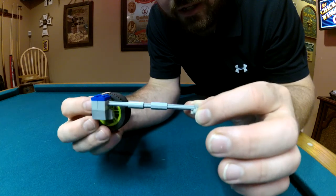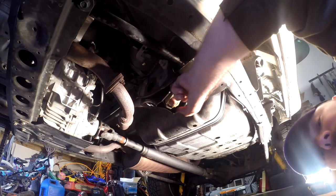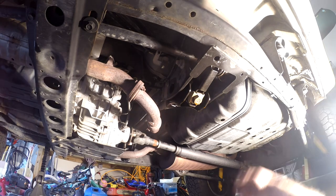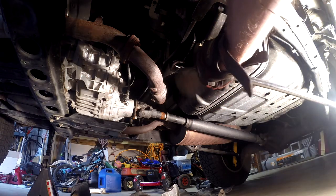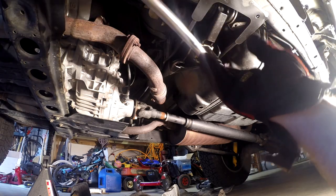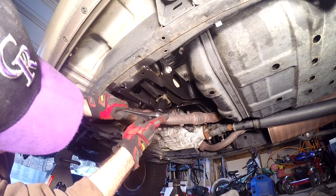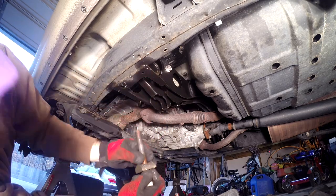It's really pretty simple — once you take it apart one time you'll start to understand how it works. Let's get this 30mm torsion bar adjustment bolt out. This is the one that screws people up, but luckily mine look almost like they're brand new. I've got my 30mm socket and I'm going to get it started with this breaker bar. Super easy — surprisingly it turned so easy I'm just going to use a ratchet. Not everyone has it this easy; if you have trouble, spray it down with some PB Blaster, give it some time, and try again.